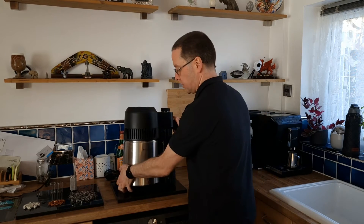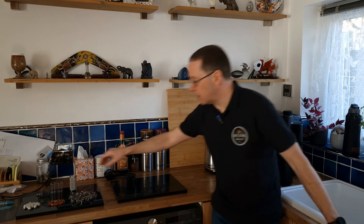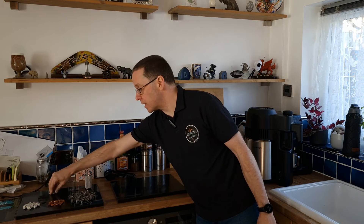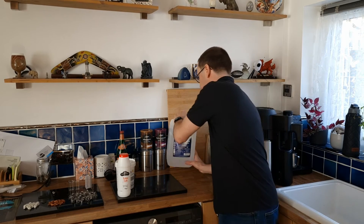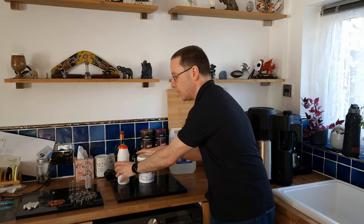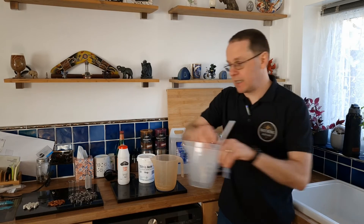Get all your different packing out of the Air Still and lay out all the parts, including the two nozzles. The Air Still Pro doesn't come with ceramic boil enhancers — I don't know why because you need them — so either take them from another still like a T500, or buy some. Lay them all out individually. To clean them we're going to use table salt and citric acid, and for the actual Air Still Pro itself we'll use white vinegar. You'll also need a mixing container and some jugs or containers to put the parts in.